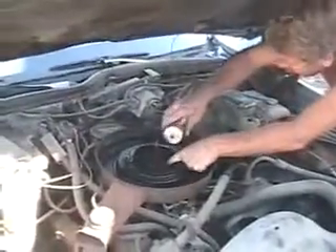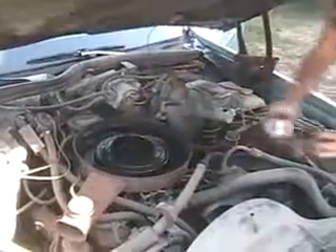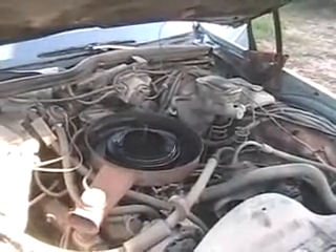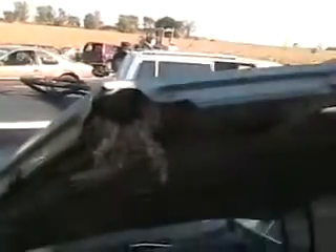Battery connection. Holy cow, this is a good one. Let's throw one more squirt of gas in there — the bigger squirt, you have to fire up a little longer. It's a bit of smoke. I think this thing sat for years and that was just like instant. Oh, no wonder there's a bit of smoke — this is two-stroke gas. One more try, 305 running on two-stroke gas. Well, it's good for lubricating the cylinders after sitting all those years. We don't have to take the spark plugs and squirt oil down them.